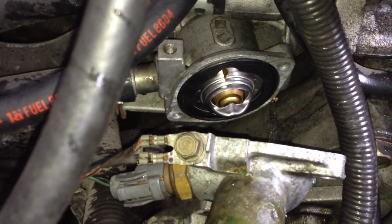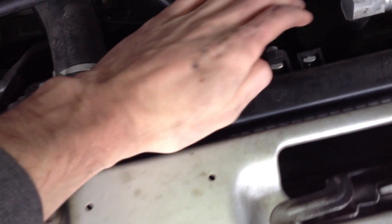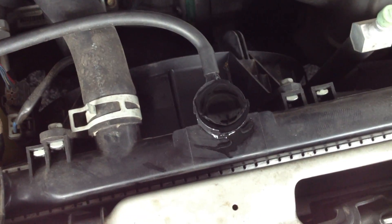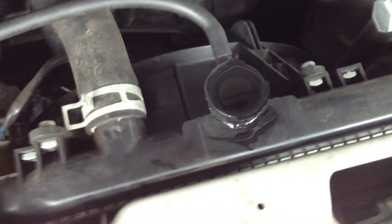Now that we've got the thermostat in there, all we have to do is put everything back together. We've got everything put back together and our next step is to add coolant fluid for all that we lost, so we need to remove this cap. This should never be taken off after your engine's been running — always have a cold engine. The level is not full so we just need to add fluid until it fills up, then we'll start it, leave the cap off so we can get bubbles out, then put the cap back on and we're good to go. Now that this is full, I've got my drain pan underneath — I'm going to start up the car. It's probably going to bubble out a little bit so I've got the drain pan to catch anything that comes out. Hopefully the bubbles will come out, we can add a little bit more, put the cap back on and it should be good.